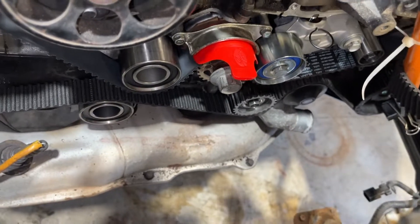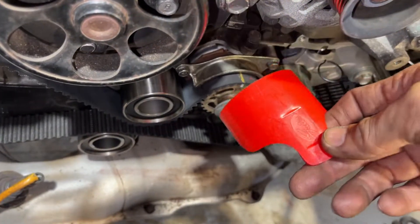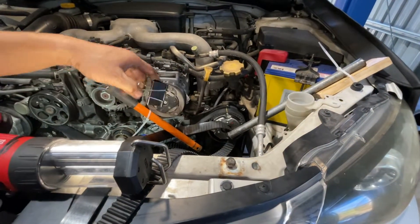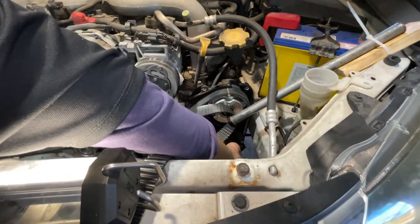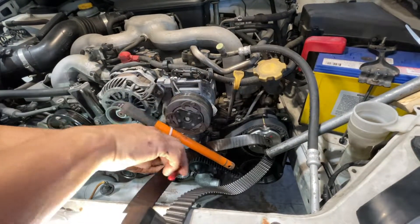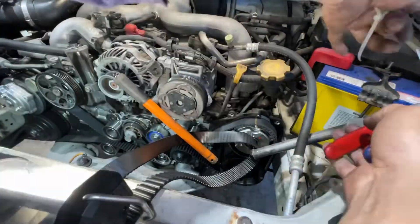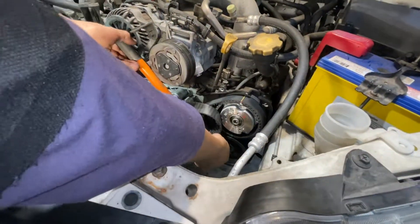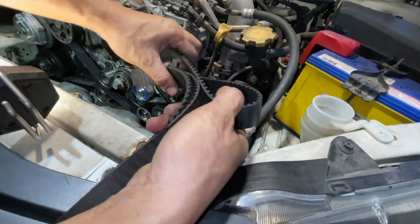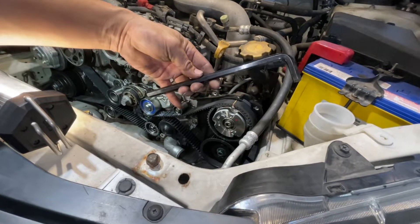Okay, that's how I installed it. Now I'm gonna remove my special tools — the clips, I'm gonna remove the clips. It's all good, it's already at timing. Remove the clip at the bottom also. Now we're gonna remove our timing special tools. Remove this clip. And we can remove the old belt here — it's a little bit tricky because the old belt is still there, but it's still doable. You'll also see the Allen and 10 mil there — that's how I do it.